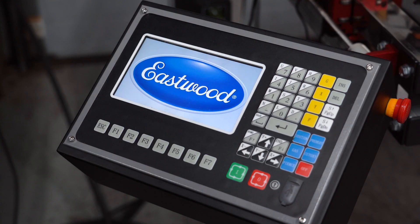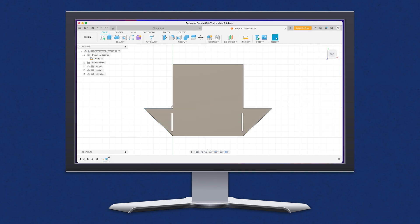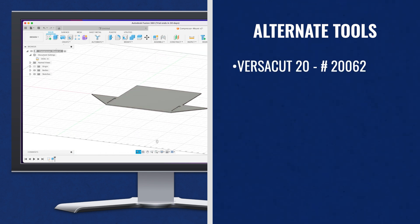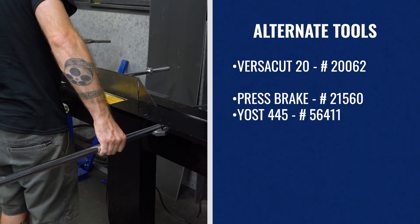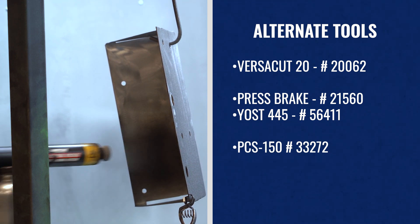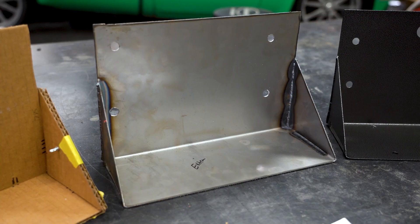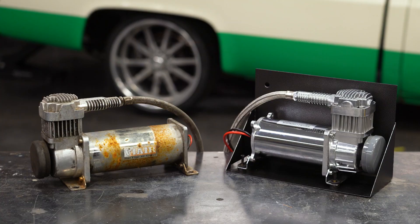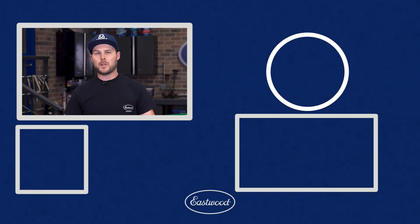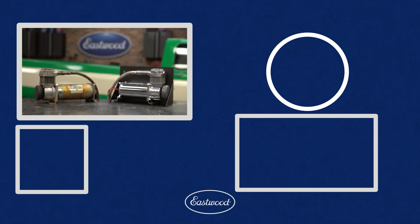Obviously we have lots of cool tools to play with here at Eastwood, and you might not have all of that available at home, but that's okay — there are lots of ways to go about these projects. You can cut these out with a plasma torch or a cutoff wheel. For bending, you could use a hydraulic press brake and a bench vise to get similar results. Powder coating can be done in a designated old home oven for small parts like these. The important thing is the process and taking your time from design through an iteration or two and top coating — you can end up with great results at home or in your shop too. If you want to tackle projects like these, we've got you covered — just head over to eastwood.com. We'll see you next time.